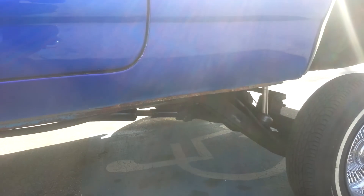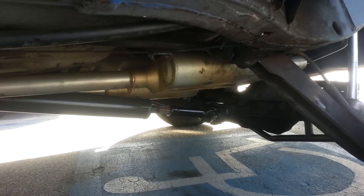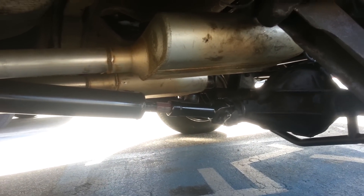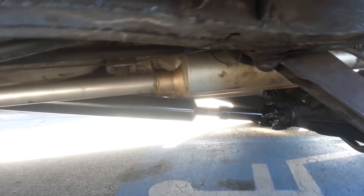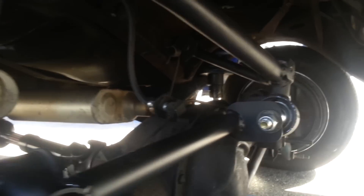We did kind of a redo on this one. This one came to us and we did new reinforcing on the bottom, extended the driveline with the slip yoke, and also did a custom three wheel wishbone in the back. I know there's not a lot of stuff out there for 65 to 70 Impalas, but just showing you guys that there is now.